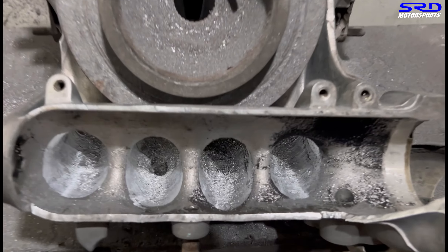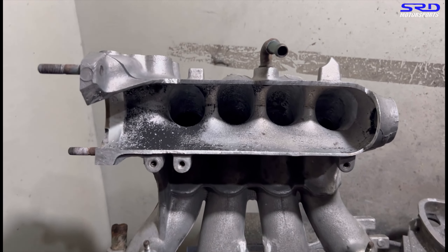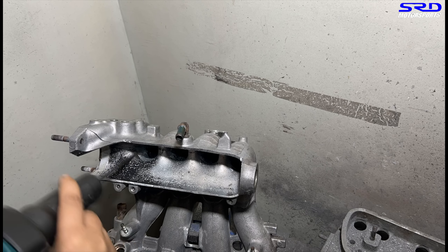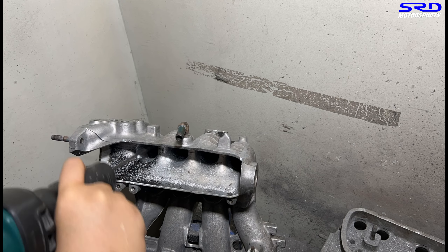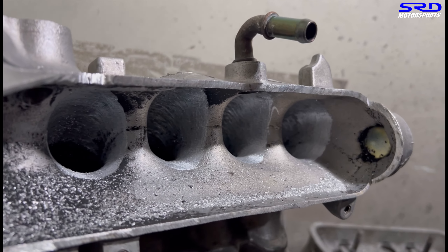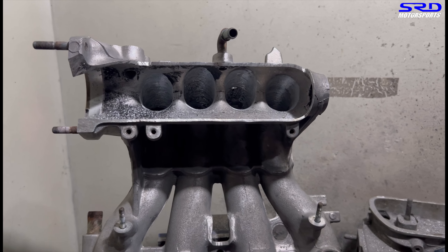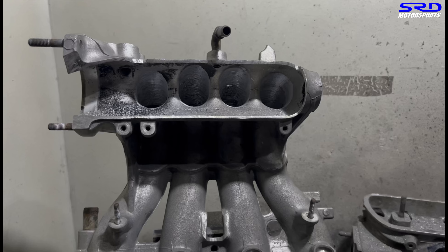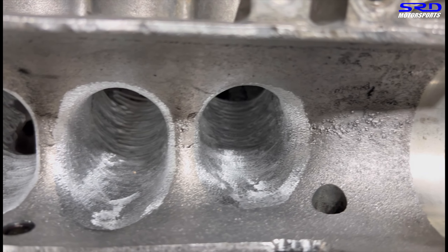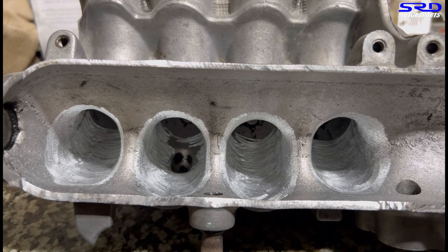Let me clip the phone and show you guys. You can see the casting marks and the horseshoe is still there, so we're just going to clean it up. We invert the manifold and now we're going to touch up on the short turn or the roof side of the runner entry. There's a bit more material here so you can actually widen it better. This is the initial stage — we've got to do a little bit more to get the shape going before we go to the 80 grit. Now we clean this up — that's the initial shaping starting now. You can still flare it some more, but we're just showing you the initial stage of how it is with just the carbide.